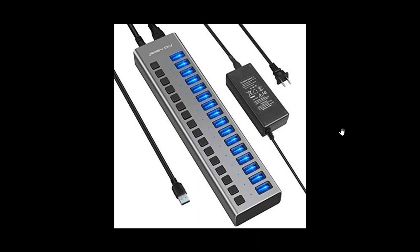Using USB hubs is also a cause of problems. Depending on the USB hub, try to avoid the cheap ones — they very often will give you errors, blue screens, all sorts of problems, and connectivity issues with devices. The cheap ones are not necessarily a good idea; you're better off putting more money into something of more quality. Remember that some devices do not like hubs at all — there are devices you'll have to plug directly into the computer because they won't work through a hub, and that happens more often than you think.